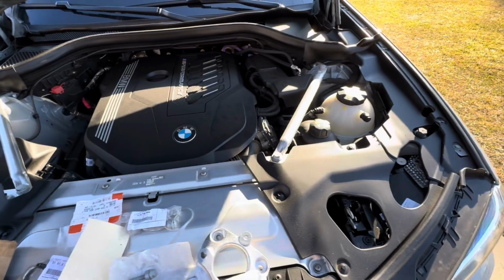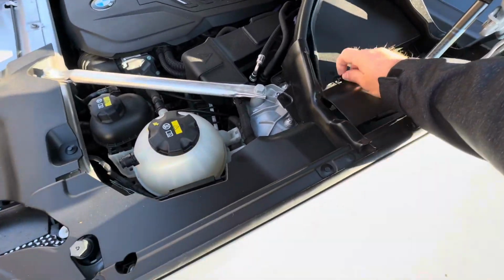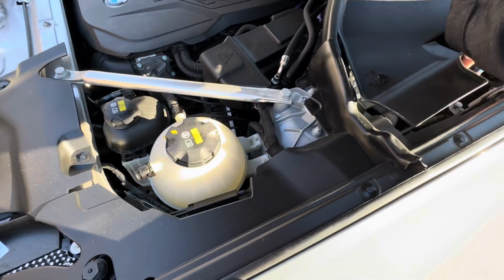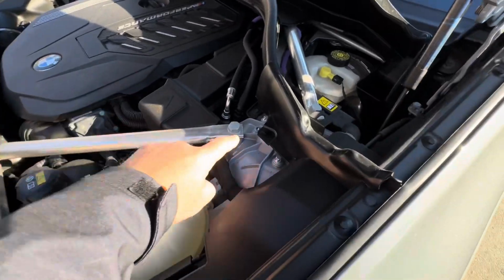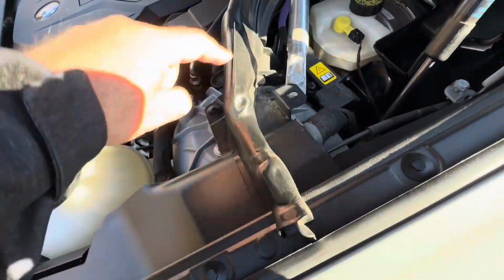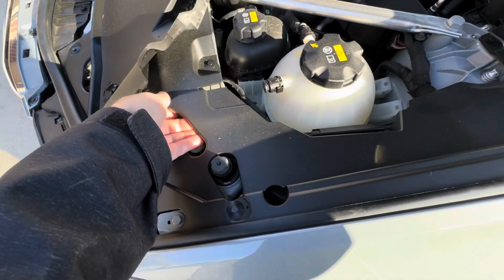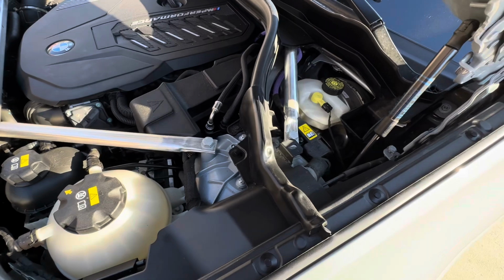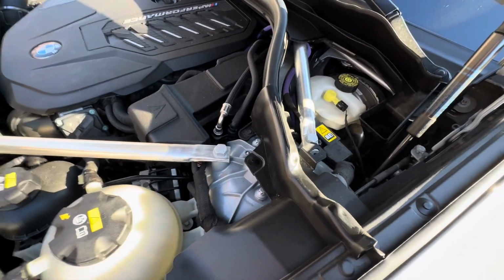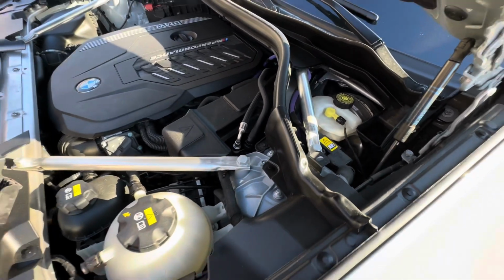So at this point, what I'm gonna do is remove this plastic side trim. Okay, so this is a brake reservoir cover, and then what I see is one of those 2-piece clips, 1, 2. We're probably gonna end up removing this one and this one and this one as well, and this just slides in there. Okay, so yes, we're gonna remove all these push clips. I'm gonna use just a basic clip tool. And then once these are off, we're gonna see what's the next step.